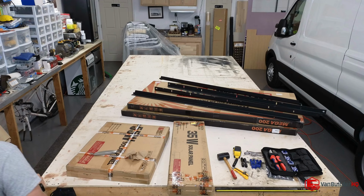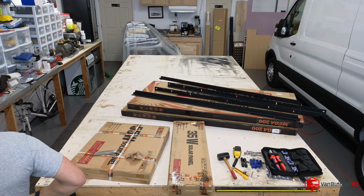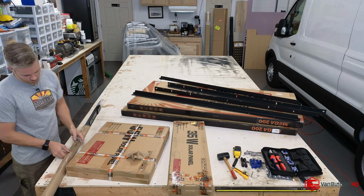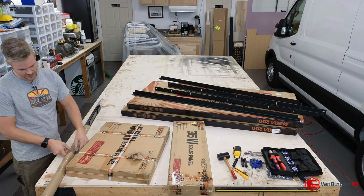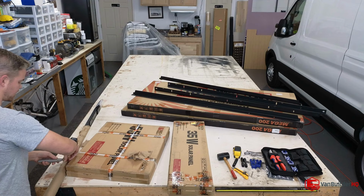And with solar, if you are going to go the solar route, my opinion is always maximize the solar as much as you can, so you can get a benefit. Because solar is not, you know, magic. There's not a lot of amperage and current. So having a big solar array is going to make it actually a usable system instead of just a kind of like a trickle charge for topping off your system.